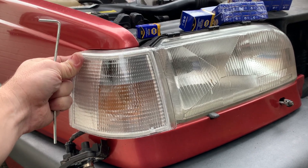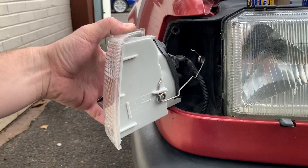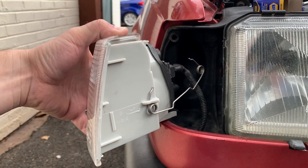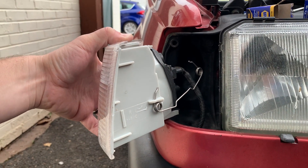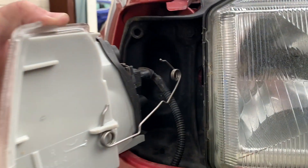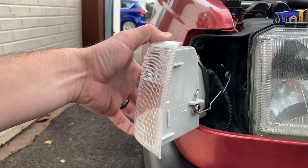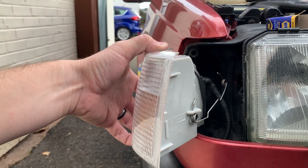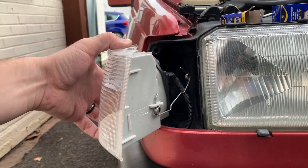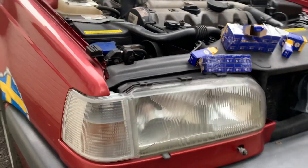I'm going to see if I can find that piece and then carry on. This has now actually got quite interesting because I didn't have a spring on this side - it's gone missing. But what I have found in my toolbox is the spring from a bracket from a Volvo 940 fuel flap, and I've just tested it and it works. So what I'm going to do is push that through and then cable tie through that loop on the spring just to secure it. I test-fitted it a minute ago and it wouldn't actually pull out easily - I had to use the tent peg. So this is going to work, I'm really pleased about that. The blue Volvo 940 that I had has donated its fuel flap spring for my 850. That is done - it's in.